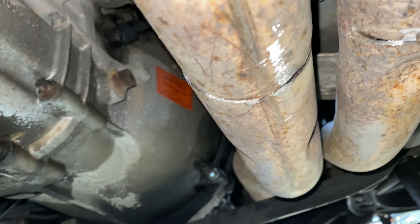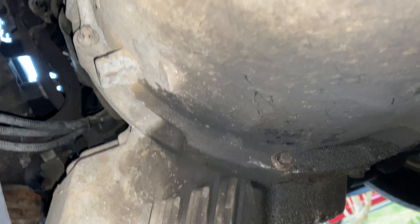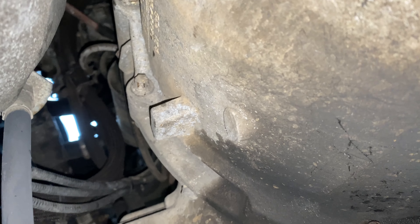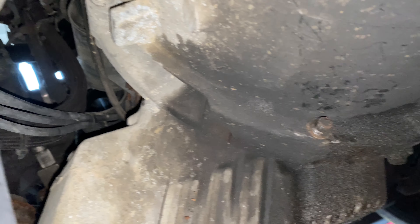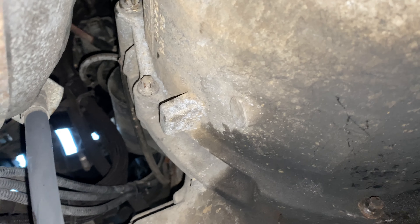Watching that video did help — I realized I was trying to get at least some of the wrong bolts. That one's working out far better than anything else I've tried. One down. Another development: some smaller bolts also need to come off. The video said those are supposed to be 10-millimeter inverted torx, however the 10-millimeter inverted torx bits I have are too small. It seems like there's a mixture of bolts here that aren't originally supposed to be on here, or someone changed them at some point.